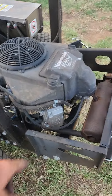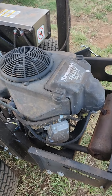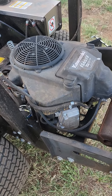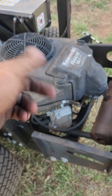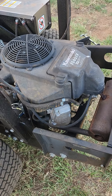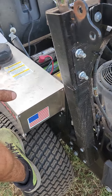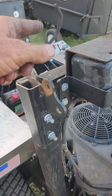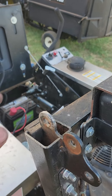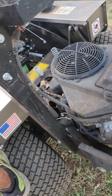After doing all that and cleaning it out, I figured out where the water came in — because it obviously didn't come in through the air cleaner; it was sitting like this. Pulled the carburetor off, got the bowl off, cleaned it up, made sure the little solenoid was working because it was stuck. Got one tank cleaned out. I'm running off of one side; the other one is completely full of really bad old gas, so I've got to get that drained out and put a new fuel filter and probably some new fuel line on it.